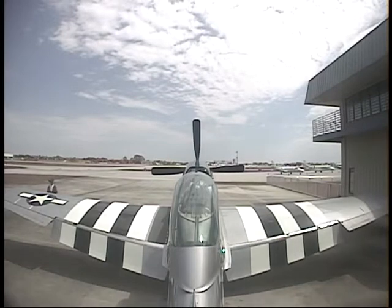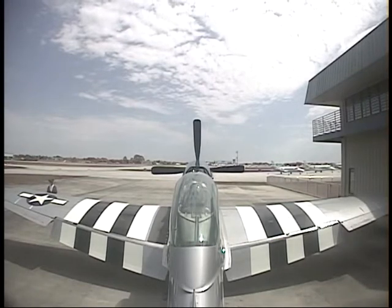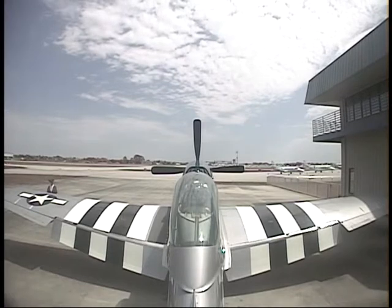We got a warm airplane here. Static gauges are set at 82 feet for the altimeter. Parking brake is in, oxygen is off, hydraulic T-handle goes in. I've got three green landing gear lights. I'm going to test the horn. 30 inches of barometric pressure, mags are off.